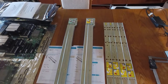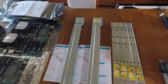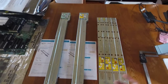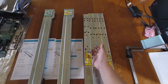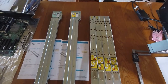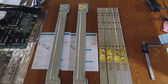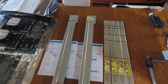For the most part they do the same thing — they will rack your 2U, 3U, 4U, and even 5U server chassis into your server rack, and they attach in an identical way. They use inner rails that slide onto hooks and can be secured with a screw, and then slide into the outer rail which attaches to your server rack.